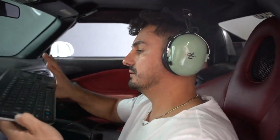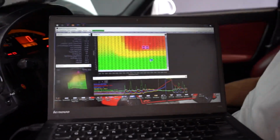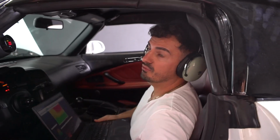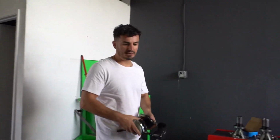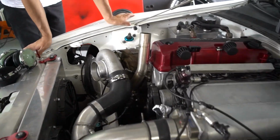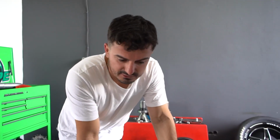That's all she's got. Fuel map, the target AFR, everything looks perfect on it. We've done what, like 6 pulls at over 940 now? Yeah, everything looks perfect. Change the AR, I can remote in and change the spring pressure to 20, or you could put in a 4-port boost controller. But honestly, if you just change the spring pressure to 20, you don't really need to run less than 20 pounds of boost in this thing anyways.